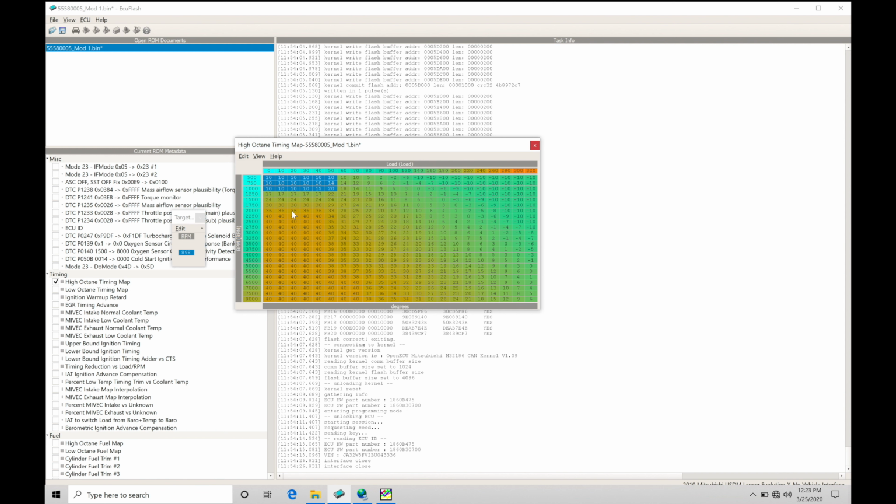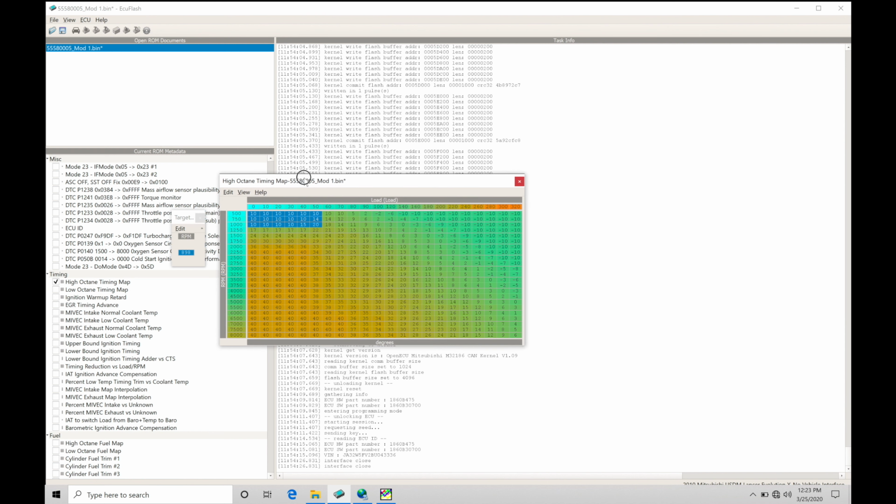Now the idle spark timing here, as we learned about our spark timing, if we have higher advance values, that's going to generate more cylinder pressure. If we generate more cylinder pressure, we'll produce more engine torque. Likewise, if we have lower values, let's say going from 10 to 5, that'll produce less cylinder pressure and less engine torque. So this area of your spark timing table will have an influence on how much idle torque you'll make. What's important to note is that when we request a certain idle RPM and we have a certain amount of spark timing, the drive-by-wire throttle body will open a certain amount to get that airflow in. If we alter our spark timing at idle, it will affect the throttle body opening. So if we bump our spark timing up, and let's say we're already hitting our target RPM of roughly 900, and we bump this idle spark up to 15 or 20 degrees, we're going to find it produces more engine torque. We're going to naturally start to overshoot this target RPM, and we're going to find that.